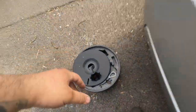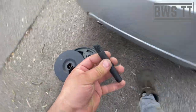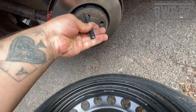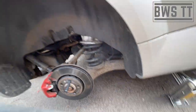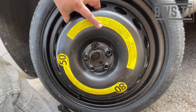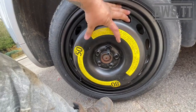If you're not feeling strong, I'll show you this - I never use it but I'll show it to you. You could use this guide - that's what it's for. Screw it into one of the bolt holes like so, and that will allow you to line the wheel up easily like so.